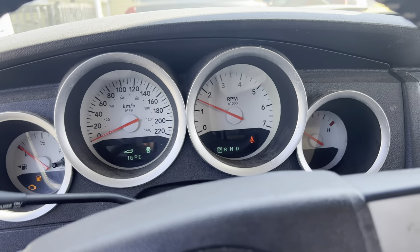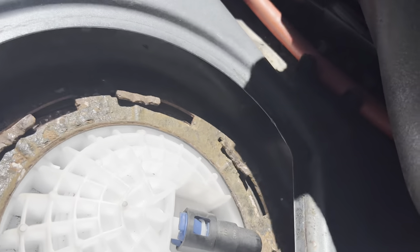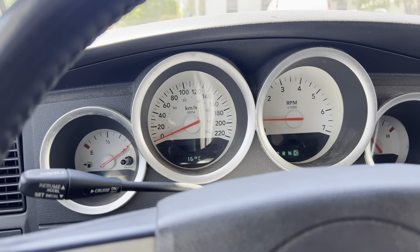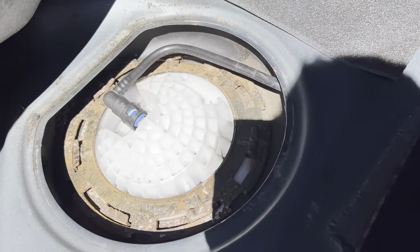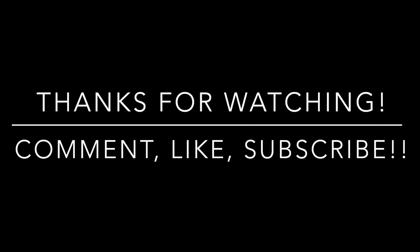Seems to be running, so time to check. I'm gonna go fill the gas tank up and make sure it's not leaking anymore. Full tank now and no leaks — it's definitely looking good on either side. I'm gonna spray some rust treatment on that and put it back together — just put the plastic caps back on and clip the seat back into place.